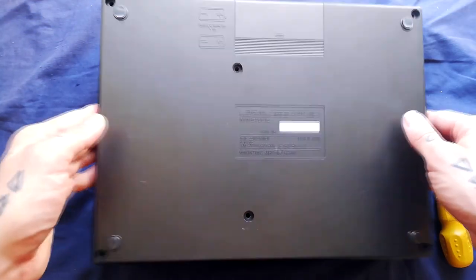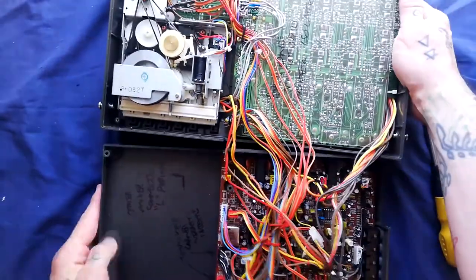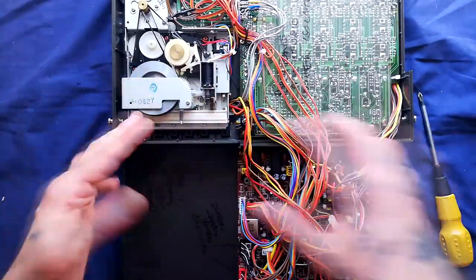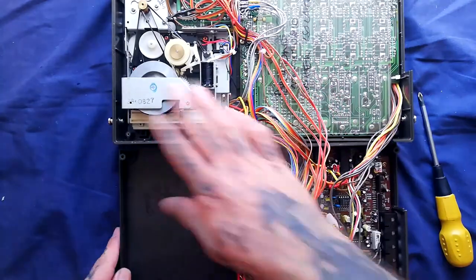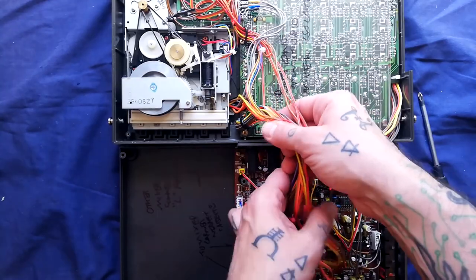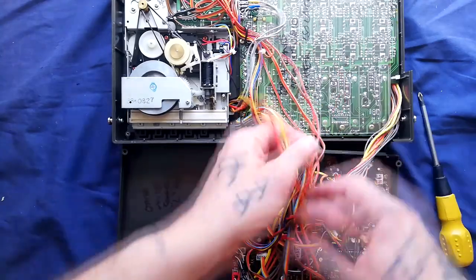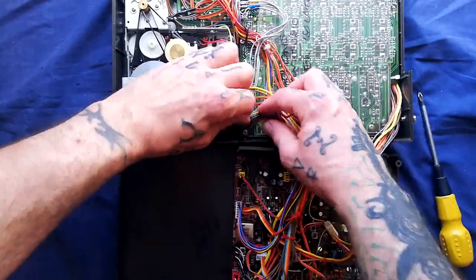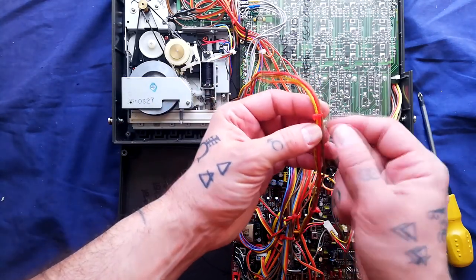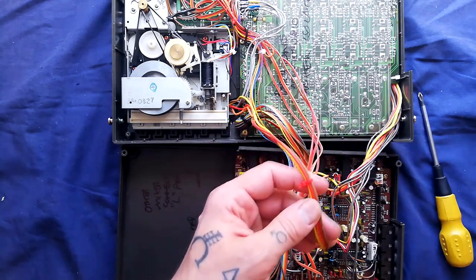Once the screws are removed, it doesn't particularly matter which way you open it because the cables connecting the two halves are pretty long. I would suggest you let those stretch out so you can put this part of the case below the other part. Because I've been in here before, I can't remember exactly what cable ties were holding this all together, so perhaps when you open it there isn't going to be as much give — just look for cable ties and zip ties holding things together. If you're careful not to cut the electrical cables, you can just cut those with scissors and replace them; they're not expensive.